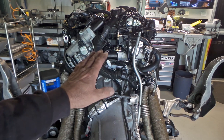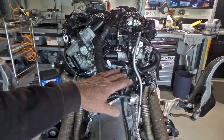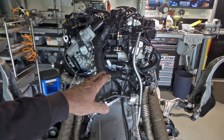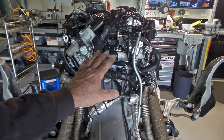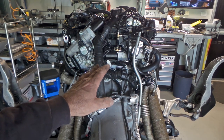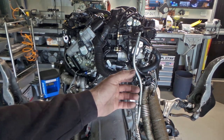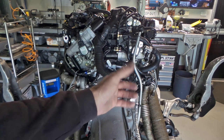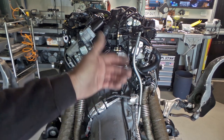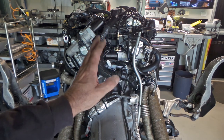Particular tight spots have always been my driver's side, right-hand side here in Australia, which is where the steering box and everything is. I imagine in the US you have the same problems on the other side. Right from day one, turbo manifolds, absolutely everything has been a huge pain in the ass to get to fit on that side. The issue that's compounded by the vehicle being right-hand drive here is the fuel lines also come up the body shell on that side, so there's even less area where the turbo and everything has been shifted to make it fit with the steering. It gets close to encroaching on the fuel lines. Everything is on that side and it just sucks.